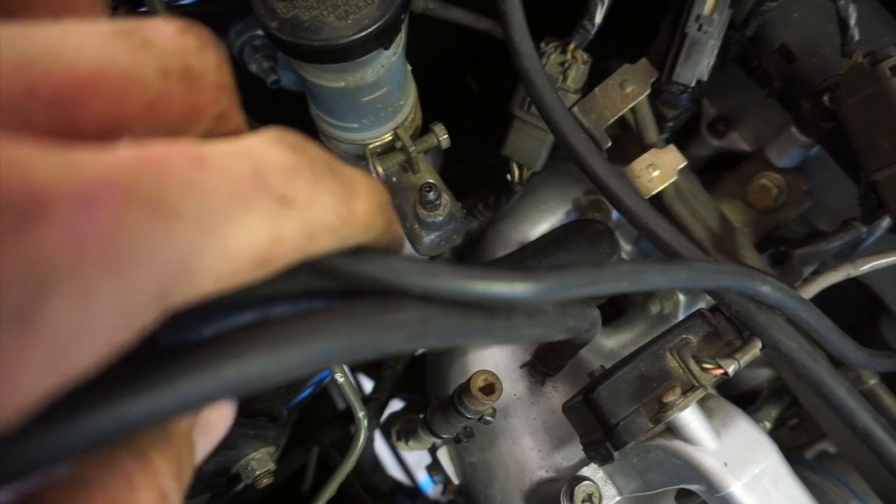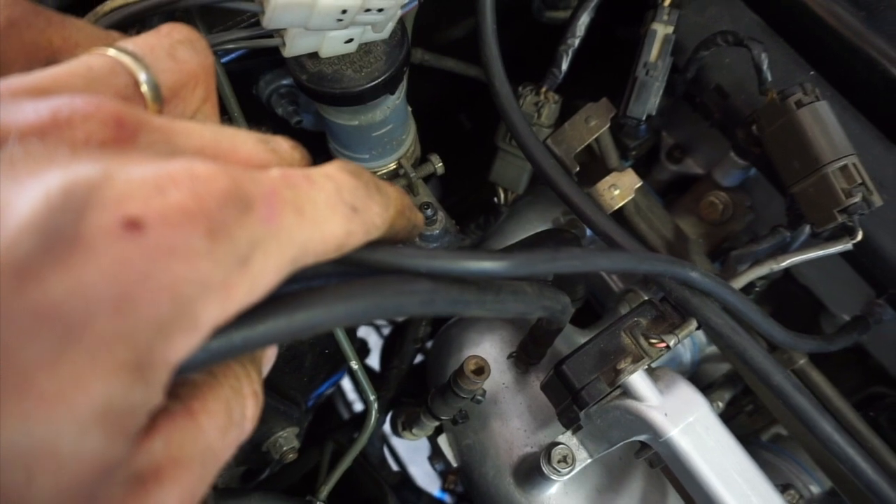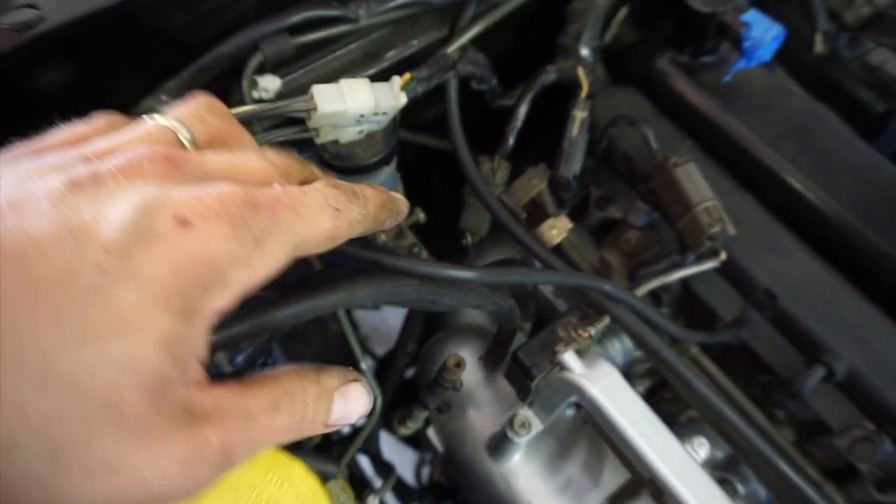It was pretty easy, not too hard. Tip for if you're going to bleed your clutch: there's actually an air release valve — a bleed screw there. We actually bleed it from there first, just push the clutch to the ground and drain the air out of that, and then did the one on the slave cylinder underneath, and that worked great. Then for the brakes, started at the furthest caliper from the master cylinder and just worked our way through, got all the air out.